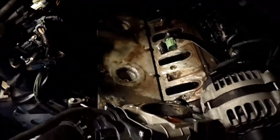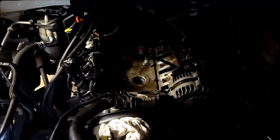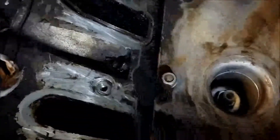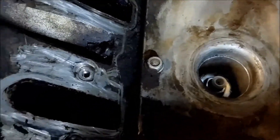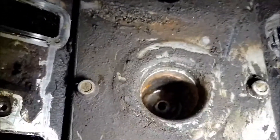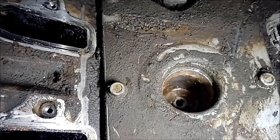That's why it's not getting any sensing from that one. There's the old wire harness on the floor. I'll seal them up — going to have to get a hair dryer or something and thaw that water out in the back so I can get it out of there. I got the front knock sensor replaced with a brand new one. That hole was nice and clean. I took the vacuum cleaner and sucked out what I could. Everything looked nice and shiny, but this back hole where the water was — there's still ice in there.